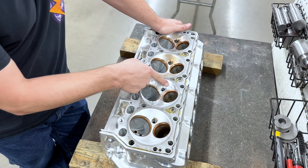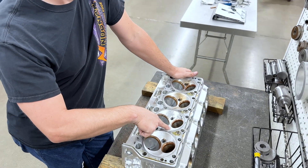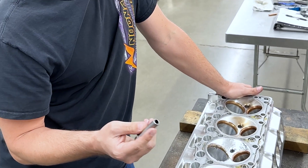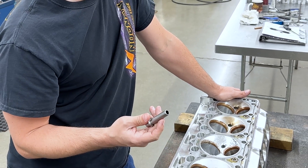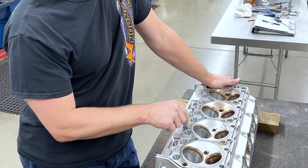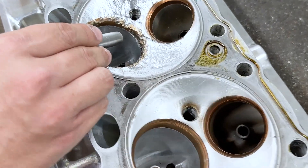What we're looking at right now is we've stripped the head of the O-rings. Daryl's already ground everything and prepared it for weld — one of the guides was bad. So I'm going to go ahead and knock the old one out and put the new one in, and that'll allow me to put it back in the Eppic and cut those nasty seats out.